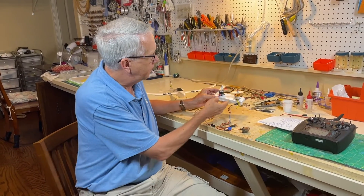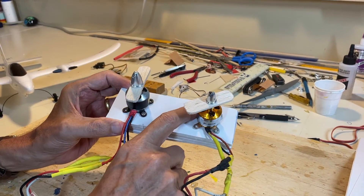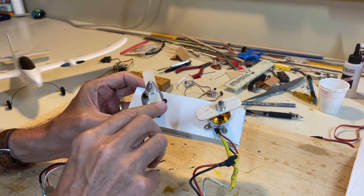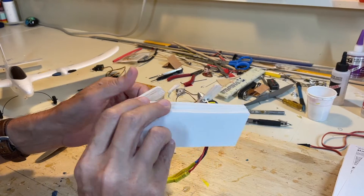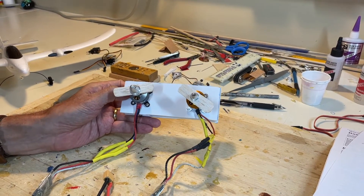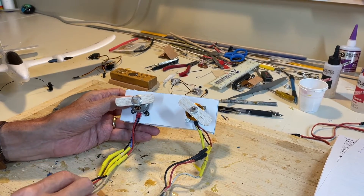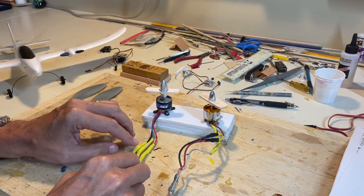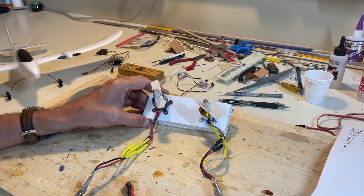This is the setup I've used for this video. I've just put four pieces of foam board together, which is enough to hold the motors for the demonstration. These are just little bolts to represent the props. Remember, when you're sitting in the cockpit, the props should rotate clockwise, so when you're looking at it from the front, they rotate counterclockwise. You need to make sure the motors are operating in the proper direction. If any brushless motor is going in the wrong direction, it's super easy to reverse — just take any two wires of the motor, swap them, and that will correct the rotation direction.